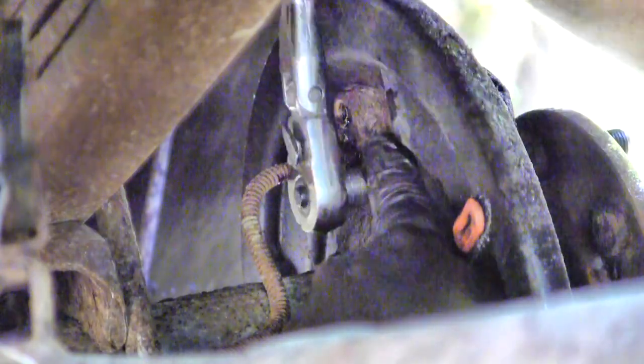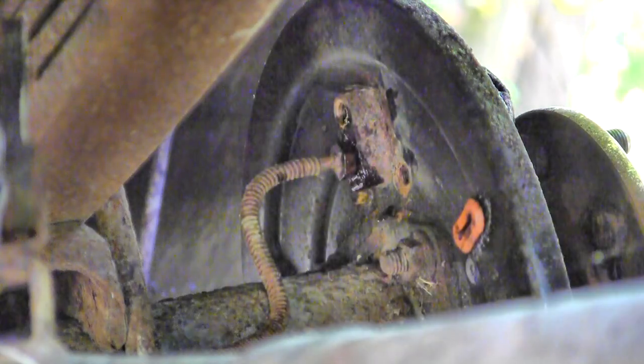Trick for you too: if the bolt or nut is so loose that the ratchet moves it both ways, get your finger on the socket. It'll probably provide just enough friction to keep it from moving both ways. You gotta save these bolts. They're not part of the hardware package or the new cylinder or anything.